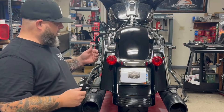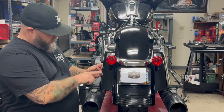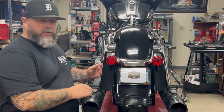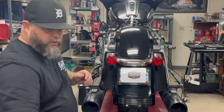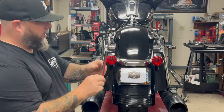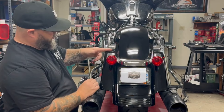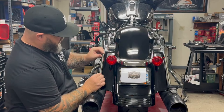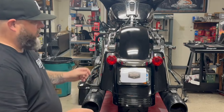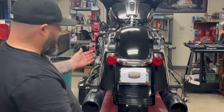I've removed the saddle bags to get them out of the way and the seat. The first thing you're going to want to do is place it on the edge of the fascia plate here, but you want to clean that with some denatured alcohol. Let it dry for one to two minutes. When you first do it, all you want to do is peel away the red film just a little bit on the top, the wire up top. Stick it on here — I usually like to try to do it where it bends at the fascia plate. Just kind of press a little bit, not a lot. Get that lined up, and then you can step back and check both sides to make sure that they're even and they're where you want them to be.